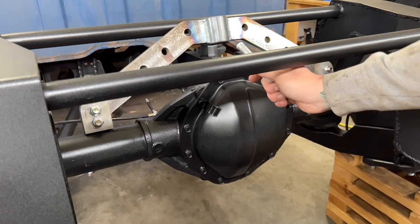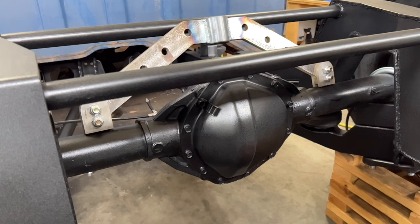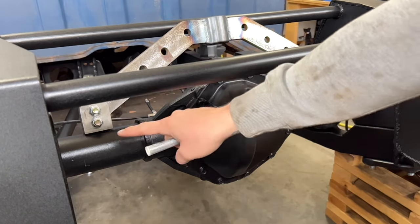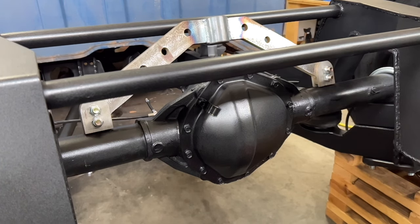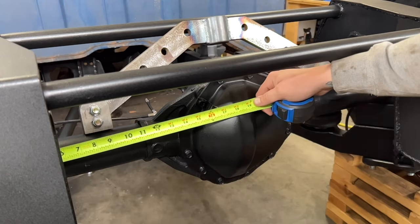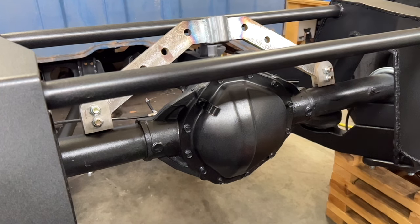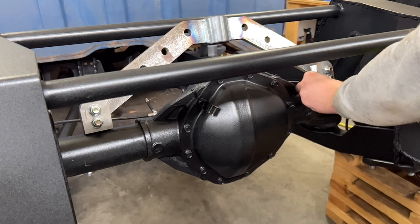The next step is finding center so we can mount these brackets on the back of the rear end. I've got this mocked up just sitting on top of the rear end — I bolted in these little tabs because those are what we'll weld into the back of the rear end, and then this bracket slides in and bolts to it. If you're running a 12-bolt rear end it's a little easier because the measurement from the u-bolt to where the rear end starts on both sides is 11 and a quarter, so we know this is perfectly centered. I measured and split the difference — one and three-quarter inches from inside to inside on each side.